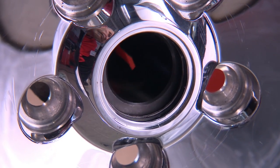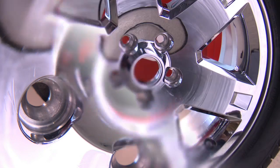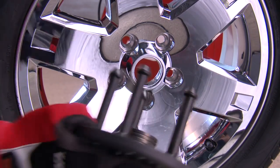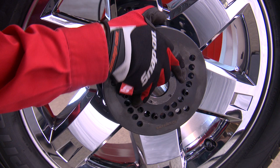This will avoid damage to the plastic cladding, as the standard cone can protrude through the pilot hole far enough to contact the outer shell. Also, the individual pins seat on the lug nut surfaces and are necessary to avoid the pressure cup from directly coming into contact with the plastic cladding.